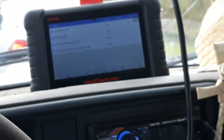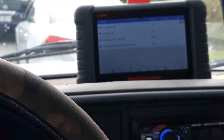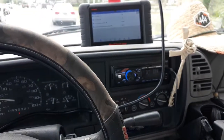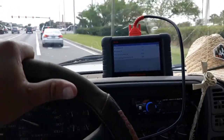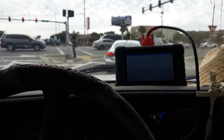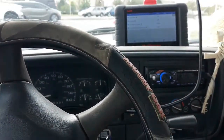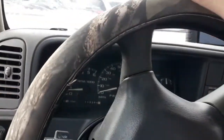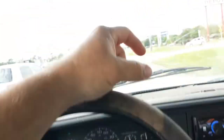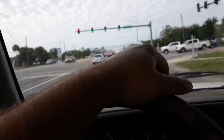So that's the problem. I wanted to address it because if you look online at symptoms of bad evaporator switches, you will see lots of stuff about how the AC will fail to come on at all. Yes, a switch can fail so it doesn't turn on anymore, but a switch can also fail so it doesn't turn off anymore. That evaporator switch on the accumulator has load on it. There's a current draw, it controls amperage flow. So over time, every time that switch opens and closes, I'm sure there's a little arc, a little spark, and contacts wear out over time.